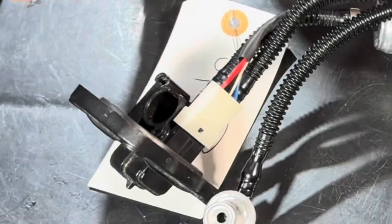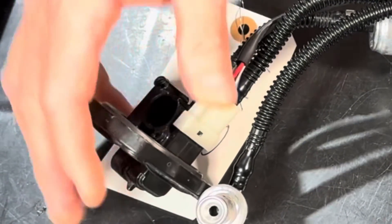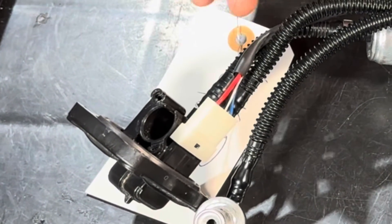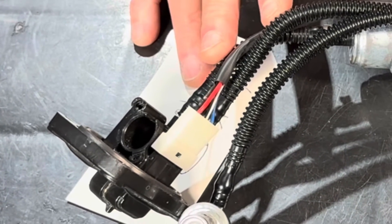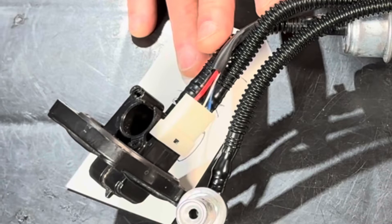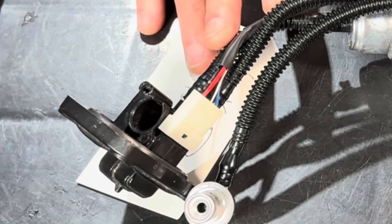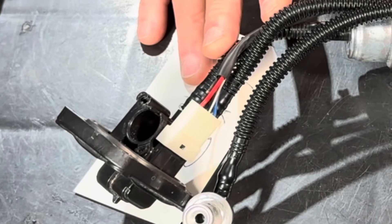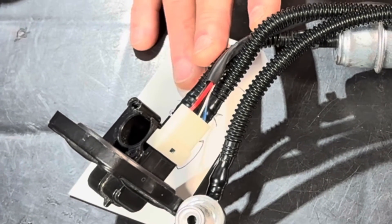So that's how we do this. If your pump works completely with no fault, then the problem is on the bike side. That could be the ECU relay, the fuel pump relay, one of the fuses, or even an ECU problem. There are a number of things that could be going on on that side. Hope this helps.